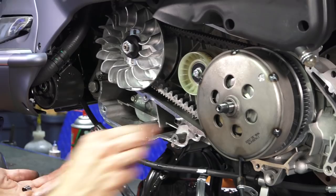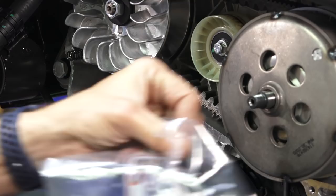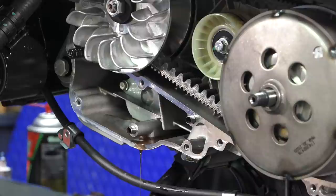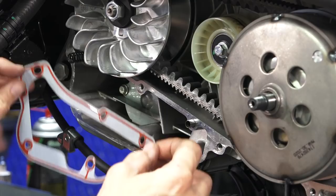Put the dowels back in place. The gaskets for these oil pans are already treated with a special layer of silicone, so that's why they're one-time use — they seal very well. The only issue I occasionally see is with a Polini belt that can rub on the gasket and tear it up, but we're leaving the transmission stock for this scooter.